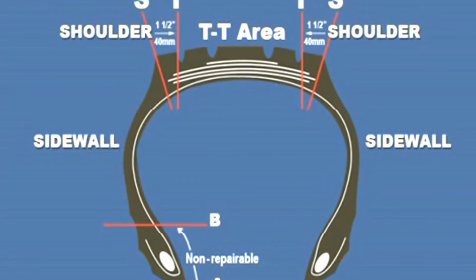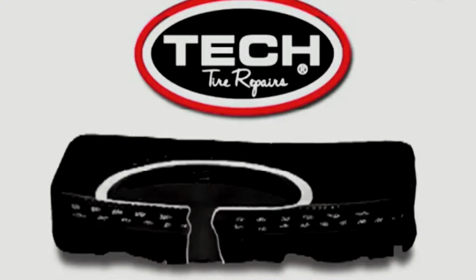Shoulder and sidewall injuries in passenger and light truck tires. The 250UL and 251UL can also be used to repair crown injuries in both bias and radial truck tires. The injury is permanently sealed and vulcanized by the Uniseal stem, while the cap seals the inner liner. Importantly, these repairs are also speed rated.